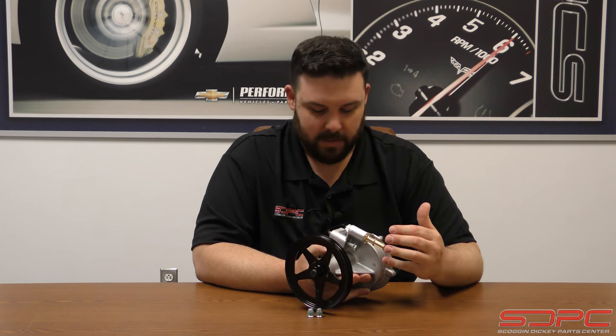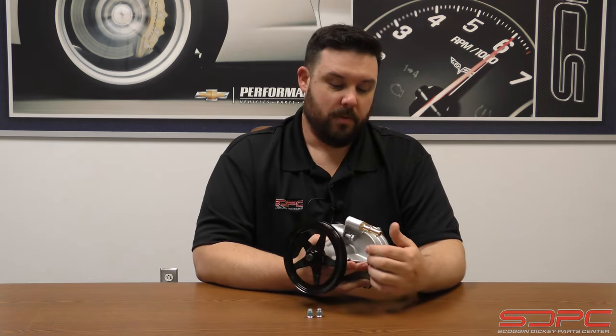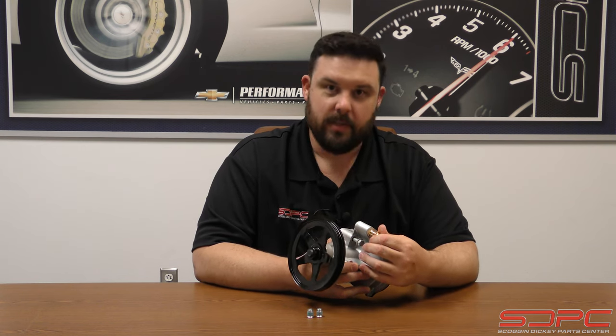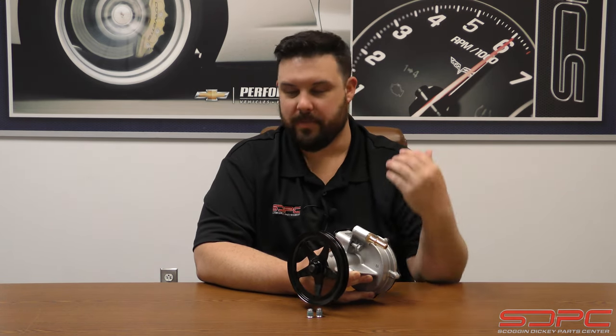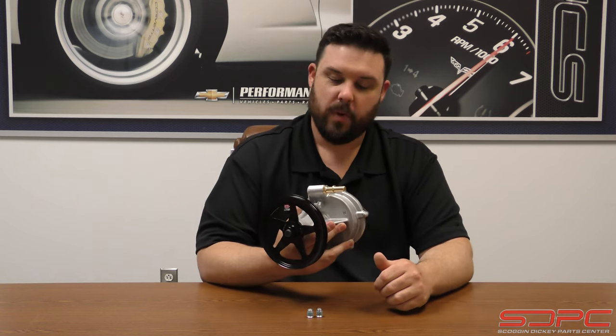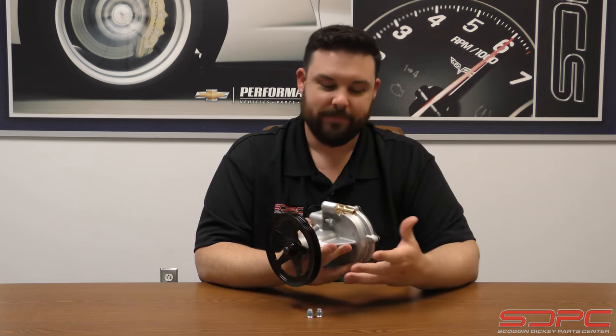Unfortunately, some of you have heard stories that it didn't work out that well. There were actually a couple recalls and technical service bulletins — TSBs — on these, and they ended up getting rid of them. The reason you did not see them on any of the older LS engines or small block truck engines is pretty simple. These engines run displacement on demand and variable valve timing, and it can cause problems with the brake booster. It was a reported issue on the 2007 to 2013 trucks with VVT and DOD — that does affect the engine's vacuum draw on the booster. So you're going down the road, DOD has cut it down to four cylinders, and all of a sudden a deer runs out in front of you like we experience out here in West Texas, and you need to get on the brakes real quick. It would take a minute to get a little bit of vacuum. Some people did report problems — it wasn't a big deal, but it would really freak you out. So that's why they decided to go to this setup. Something mechanical and reliable, unfortunately proved to be a little unreliable.